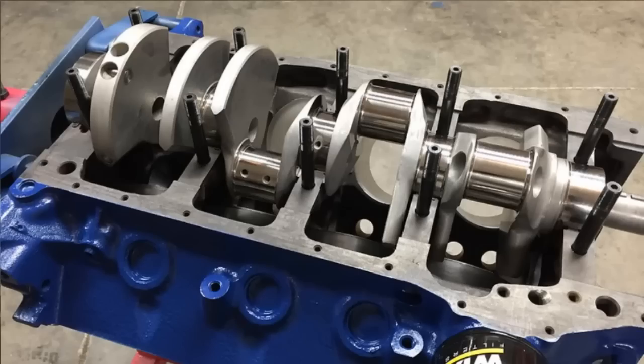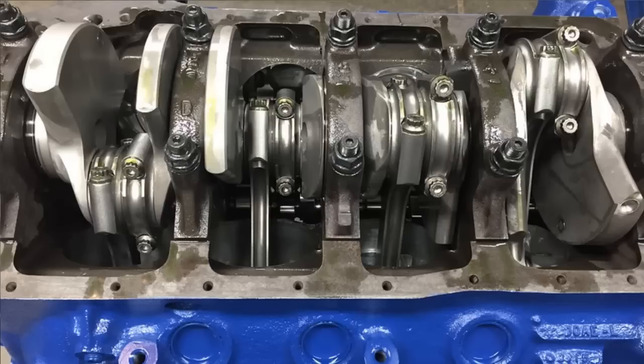The crankshaft was a super light stock stroke Cleveland mains, so you can run those in a Cleveland block or in a 2750 main Windsor block, like the new aftermarket blocks. It has small block Chevrolet rod journals on it. So we used a Molnar 6400 length rod, and that is not typically a rod length that guys usually reach for.